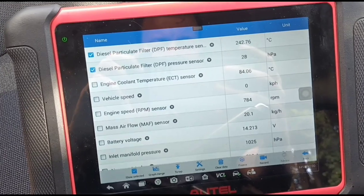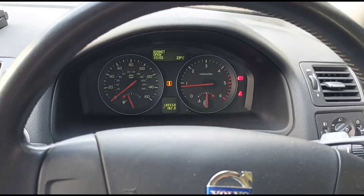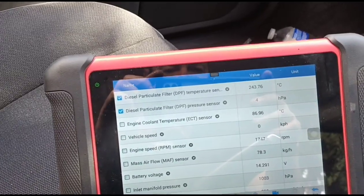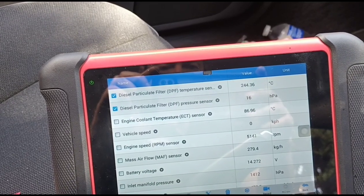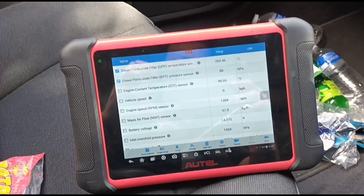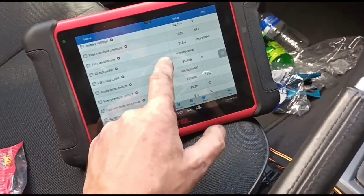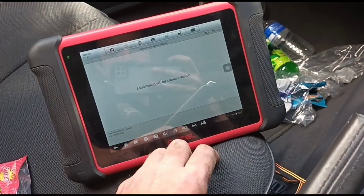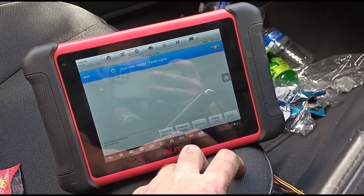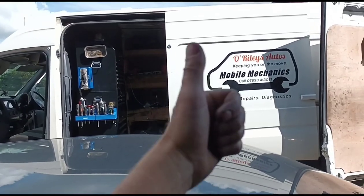It's a little bit higher than I'd like but it's in a reasonable area. I'll do a full load acceleration for a couple of seconds to see where it goes. We get 62 millibars - that's plenty good enough really. Going back into the codes we're just left with the glow relay fault. We'll come back and sort that out on another video. See you next time.